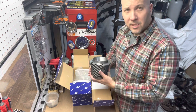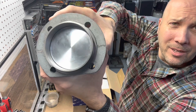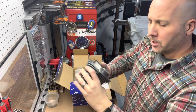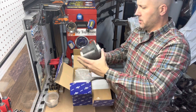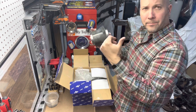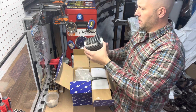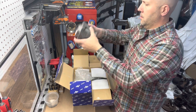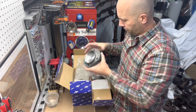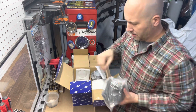That's a nice bolt on it — it's marked 87.95, you can probably see it in there, and it's also got the arrow marking so you can always keep that arrow pointed toward the flywheel. So this one pointed toward the flywheel — this is going to be number one, because the flat side is on this side. So number two is going to be on the other side, and then three and four will be the other way around. Very excited — just like a kid on Christmas.